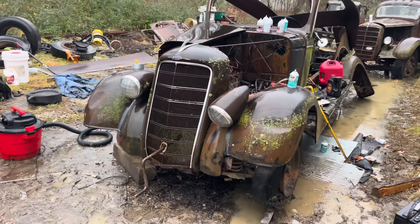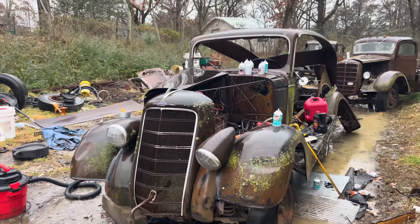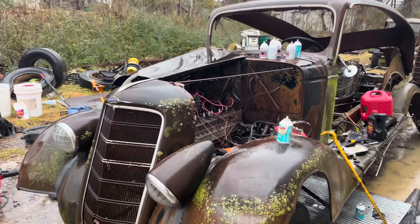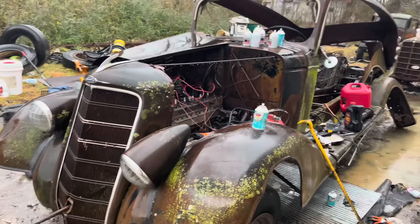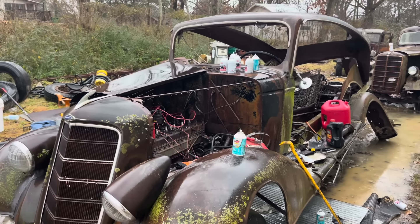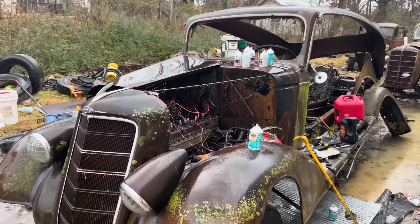It's pouring down rain today, but we've been hand cranking it since the flywheel and the starter kind of gave up on us. We cannot keep this thing running. I'm going to say the rings are just absolutely gone, and it may have been parked because the motor was somewhat worn out when the flywheel broke. We've done everything - pulled the head off again, re-timed the distributor a million times. We put a fresh rebuilt Stromberg carb on there and it didn't work off that either. We adjusted the timing everything a million times, but we did kind of get it running, so I guess we'll go with that. It kind of ran. We may revisit with a new flywheel, new starter, and some other stuff, but it's probably going to need a rebuild. Thank you guys for watching - maybe consider leaving a like and subscribing because we've got a lot more cool videos coming to the channel.